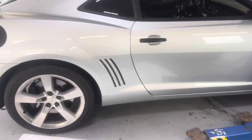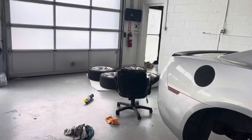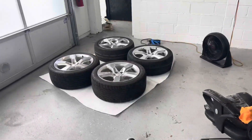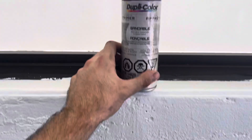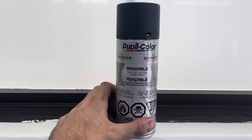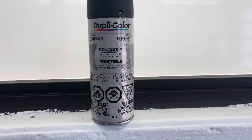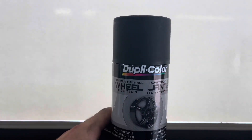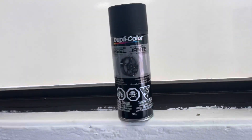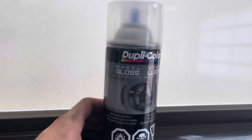Next we're going to jack the car up and get the wheels off. We got the rims off the car — we have them over here. We're just cleaning them all up, making sure there's no more brake dust. I'm just going to go over the products we're using for today's job. We're using this Dupli-Color Primer — it's a black sandable primer, so it's pretty much going to fill in all the scratches and some of the minor dings on the wheels so we can go ahead and sand it down. Once we put a few coats of that on, we're going to add the Dupli-Color wheel coating. The primer is black and this is black, so it's not going to alter the color of the wheels too much. And then to finish it up, we're going to go ahead with the Dupli-Color wheel gloss clear coat.